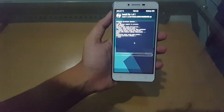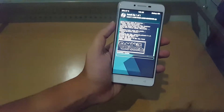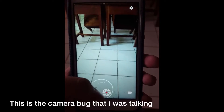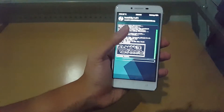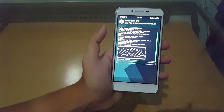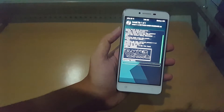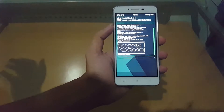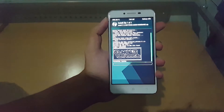Let me just install it — it'll take some time. I do have a recording bug that I'll show you guys in this video. Also, on the newer build for the Resurrection Remix ROM, the SIM card data is not working straight out of installation, so you have to add a custom APN for your network, which is a little bit annoying. I don't really recommend installing this Omni ROM — I installed it yesterday because I wanted a new ROM, and while I like the performance, those two bugs haven't been fixed yet. So I'm just going to use it to show you guys the Puck iOS ROM mod.